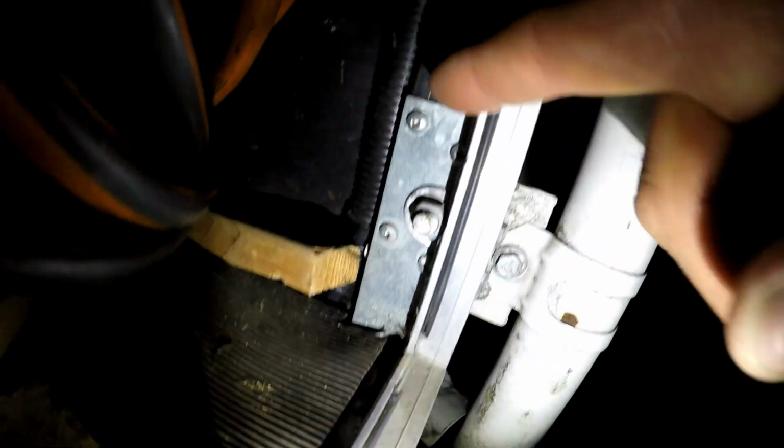Over on the right rear of the camper, the camper before I bought it had the aluminum corner added to it to strengthen the jack on this side too. And so the attachment method is different on this side, because you can see the aluminum doesn't extend down and intersect the mount bracket. So what I did on this side is I have a Simpson bracket.